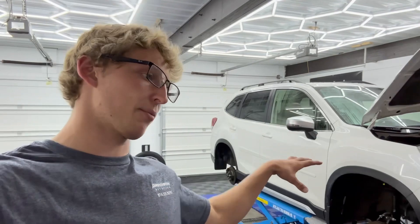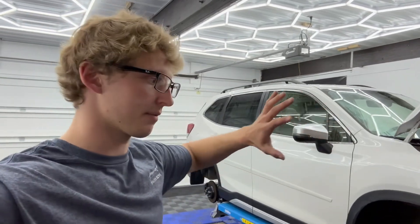That's why white vehicles sometimes look a little discolored and almost have an orange tint to them — that orange tint is from iron buildup. During the prep process we remove all of that and make sure it's gone before we start polishing the vehicle.